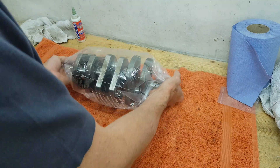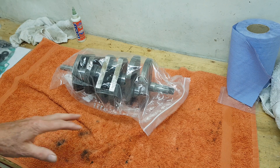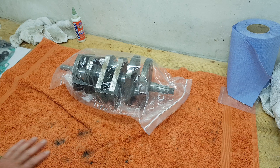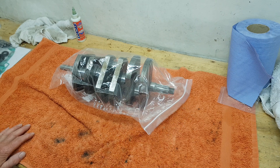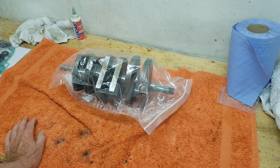I'll put that aside and then carry on and clean out all the crank cases that have been vapor blasted, because they'll be full of vapor blast grit which is a complete nightmare - you really need to get rid of all that abrasive grit. If it stays in the oilways you're asking for trouble. Anyway, crankshaft cleaned and ready for assembly.